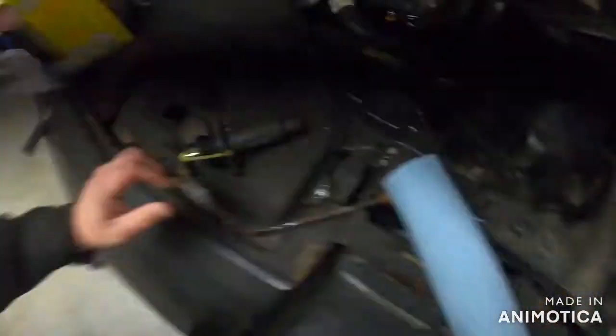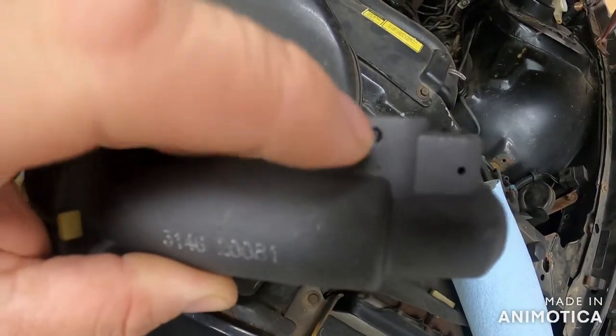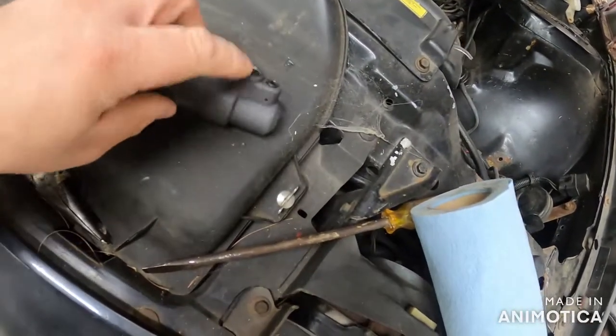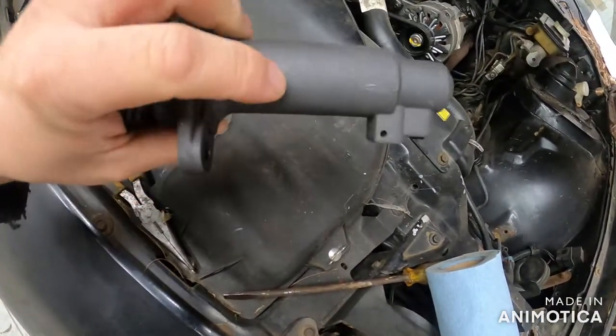With the little center punches, you have to knock this dowel pin out. Then hopefully I can get that line off of there without a whole lot of hassle, because it fits down in here and there's a rubber O-ring seal. This one is Dorman — this one is a metal replacement, probably way more better than the stock one. But the stock one did last, and it actually would have worked just fine if I didn't decide to replace more parts.